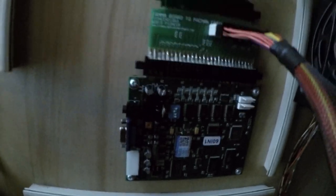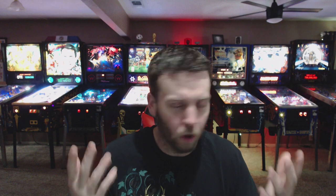Here are the dip switches on the board — there are only four of them. You want to go into test mode to make any setting changes you want, and that's also where you're going to be changing how your monitor is getting the video signal. And that's pretty much it. The video shows you how you're going to be hooking up the boards and where you need to connect the power to.